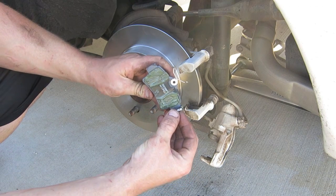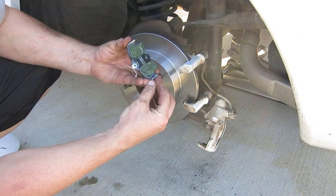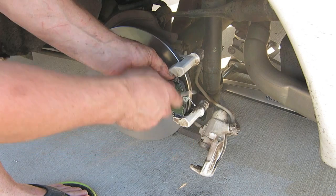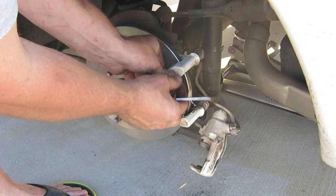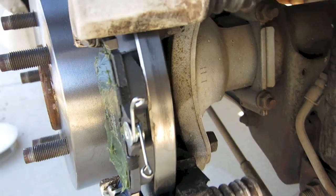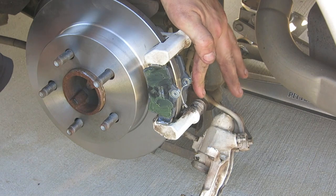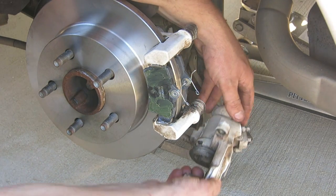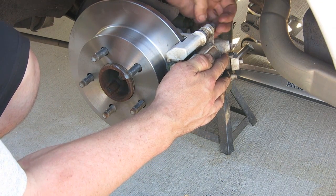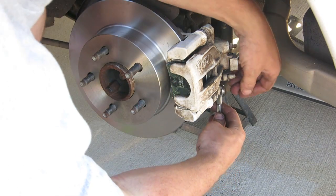Now time to put the new brake pads on. Put these little clips on the side of the brake pad to make sure they have a snug fit — you may need needle nose pliers to get the clip on correctly. It's a little tough to get the brake pads in because they're really snug and you have to line them up just perfect to slide them in. It takes a little force to push them in there. Get the outside on, then put the inside on. You'll notice these little tensioner springs that press against the caliper itself. Then take your top bolt and put it in, and take your bottom bolt and put it in. Get your socket wrench and snug them up — remember you'll have to use an open-end wrench for the bottom bolt.